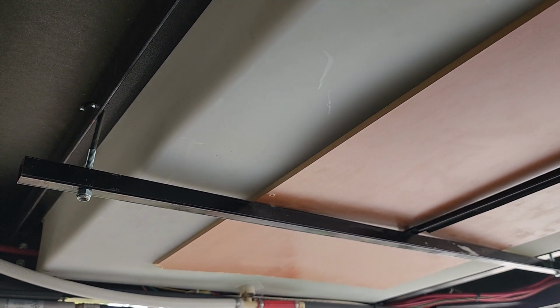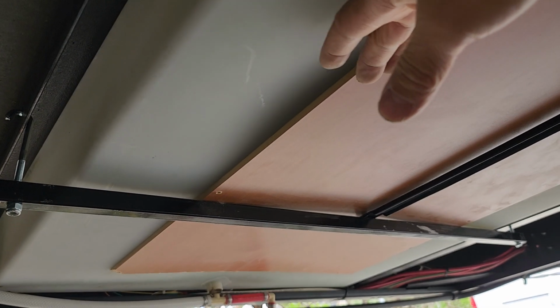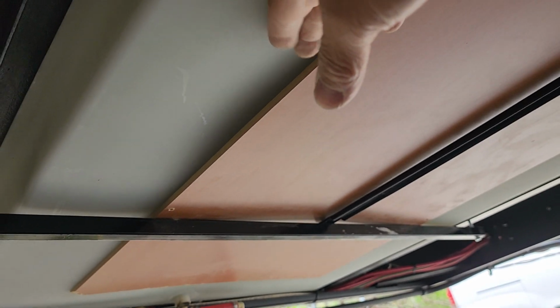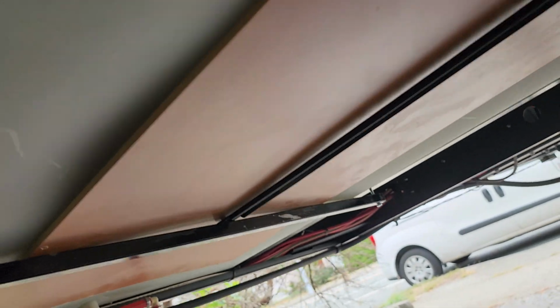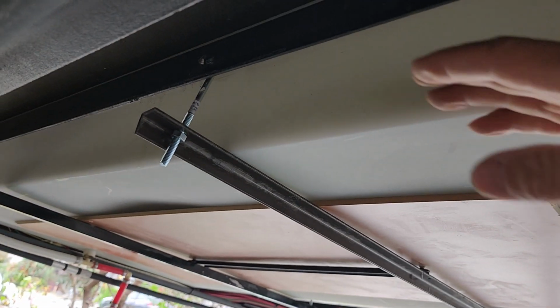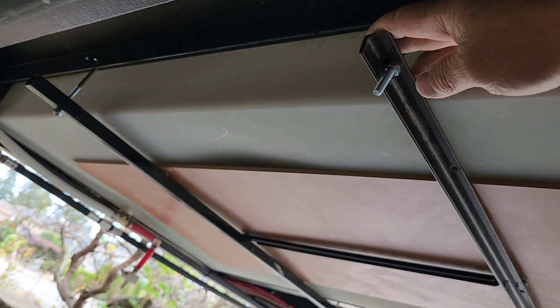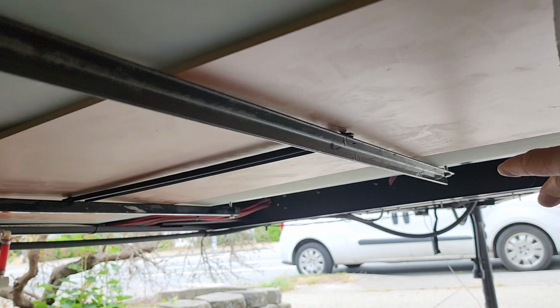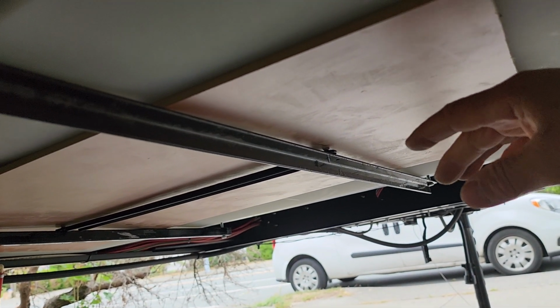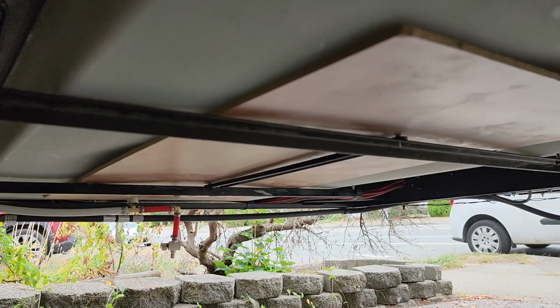but this only holds the top edge, so the bottom has no holding. That way the plastic sags down from the middle. That way causes trouble. So we use 2 frames about 20 inches apart from here to there. This way supports the bottom of the water tank, and solves the problem.